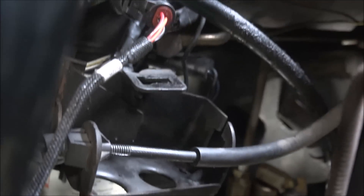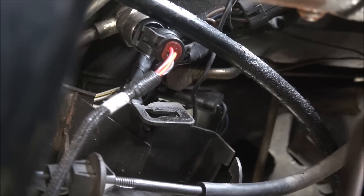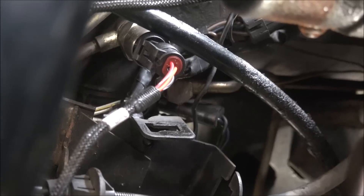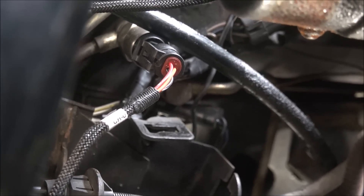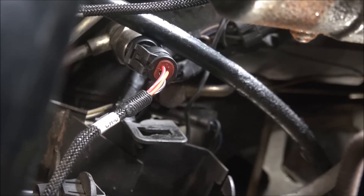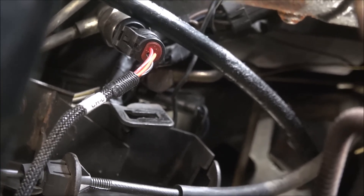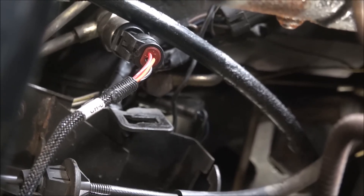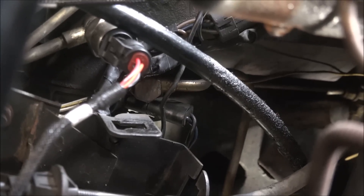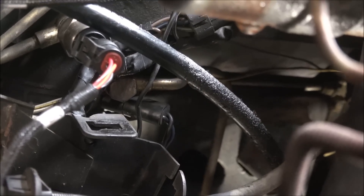This truck does still have the insulated cover on the rocker box — well, not really the rocker box, but I guess it would be the cam lifter gallery. That tin cover covers up where the lifter bores and push rods are, so I guess it's a push rod cover. No doubt that's an area of noise on these engines, so they put a noise-damping cover on it to quiet them down some. I doubt it helps, but they must have thought it was worthwhile.